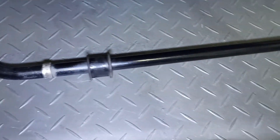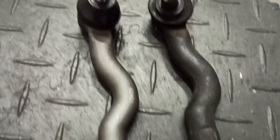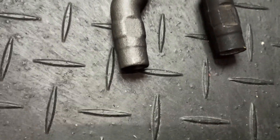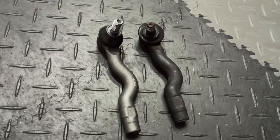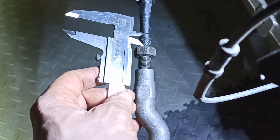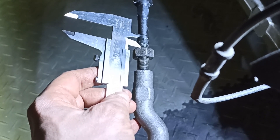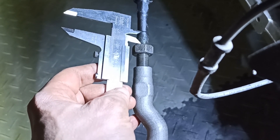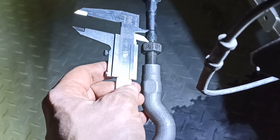To gain space I removed the anti-roll bar and will now install it back. The anti-roll bar is back in. Now I'll install the tie rod ends — I recommend aftermarket ones. The aftermarket and the original ones look pretty much the same, so it shouldn't be any issue to use one of the better aftermarket brands. I measured before removing the old steering rack the distance between the nut and a marker, and counted the threads. I'll use exactly the same distance now — this is as exact as I can do it, and later I'll bring it to the dealer to realign the whole suspension.